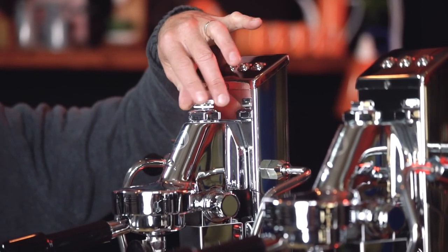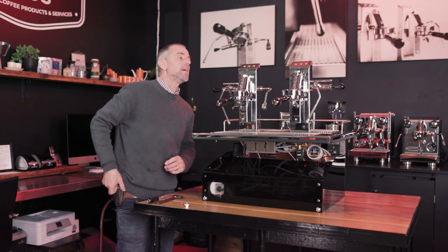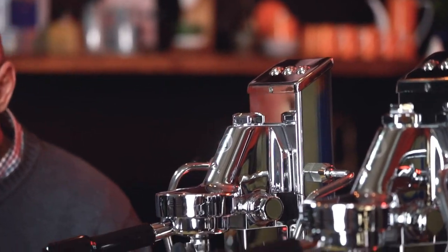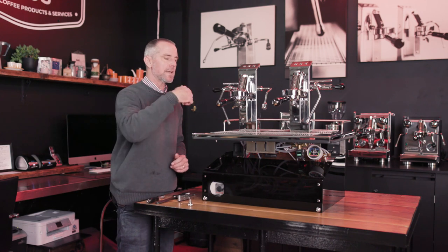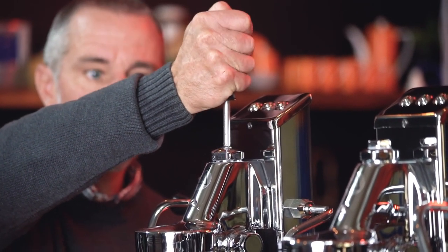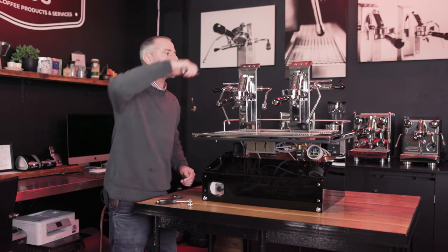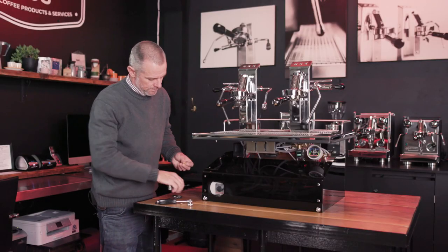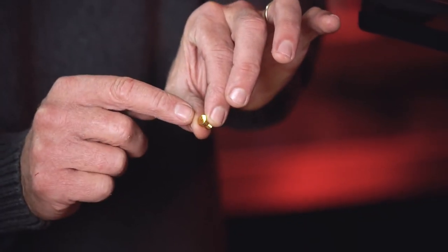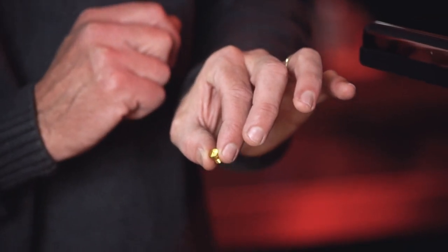To clean that out, first of all we need to have the water off and the machine needs to have cooled down. Here we've got a machine that has been allowed to cool down and we've turned the mains water pressure off. We're going to inspect and possibly replace the group jet. We simply undo that — it does need to have cooled down because there's high pressure and hot water there. We've got a little water filter screen there that protects against scale. Then in here we've got the little jet, which a number seven socket fits. We simply unscrew and extract it. This one hasn't got any problem because it's a brand new machine and this is a demonstration only. But if it's been sitting for any length of time, a tiny little speck of scale will build up there and stop the whole group head from working.